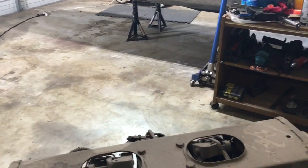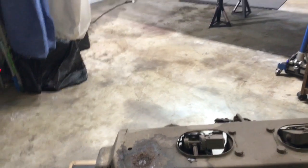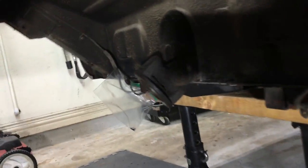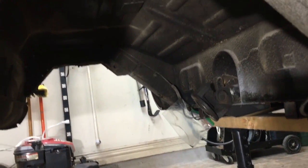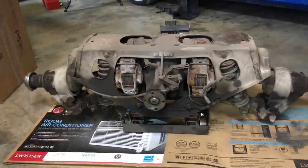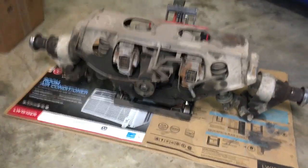But I think what I'm gonna do is vacuum it, and then probably just spray some super clean on it, just to let it start eating away at the rust preventative. Now that we've got that out, I'll be able to finish welding the back edge of the floors in. Of course, I've got to get all the undercoating out. Seems like it's dry and flaky, so hopefully the needler will work for most of it. Otherwise we'll have to heat it and scrape it. So that'll be really unfun. But otherwise, I get to move on to something mechanical, which is always better than body work.